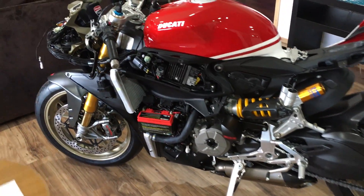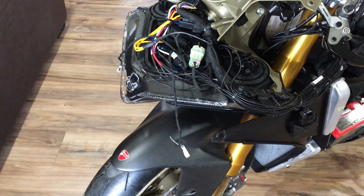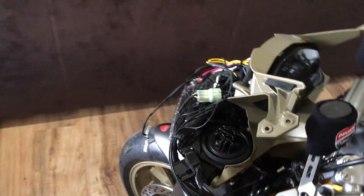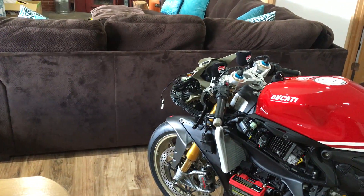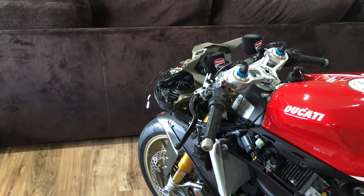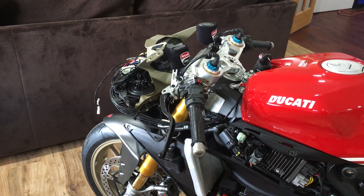The other electrical mod I'm doing while I've got the bike apart here is a headlight mod. The low beams on these LEDs are great for short distance and the high beams are great for long distance, but it seems like you kind of lose out on that mid-range when you turn the high beam on. So what I did was wire up another relay so that when you kick on the high beam, it leaves the low beam on.